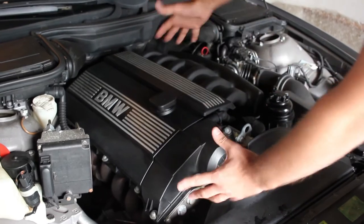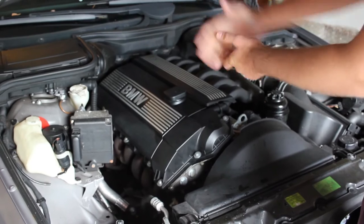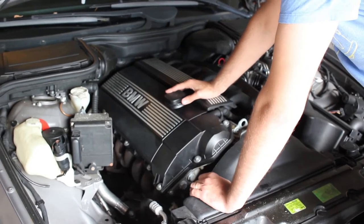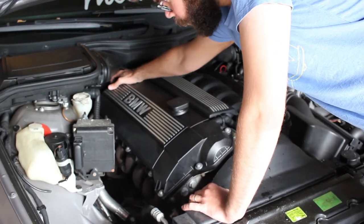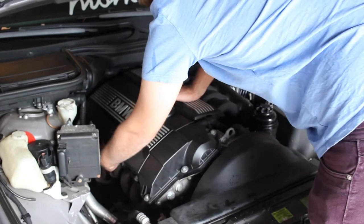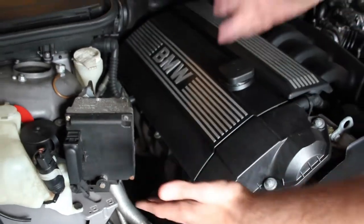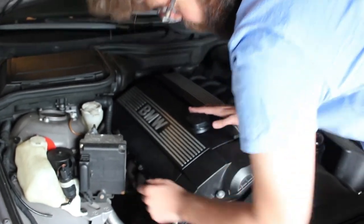Due to the size of this immense six-cylinder engine, it has been slanted a bit to fit under the hood line. Because of the length of the block, the gaskets tend to wear out quicker. There are heat cycles and a lot of heat at the end of the block. If you feel under the valve cover, as you can see, the valve cover gasket is no longer sealing. And because it's slanted, that leaks onto the exhaust manifold, which is right underneath.